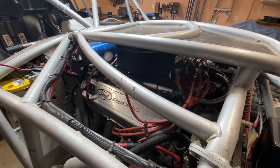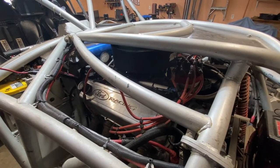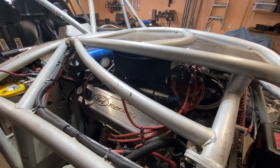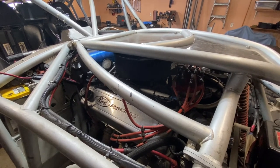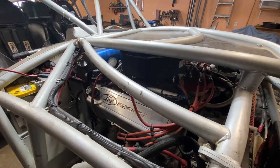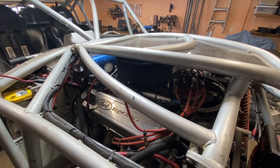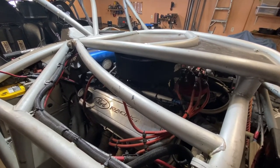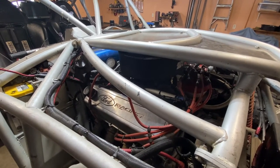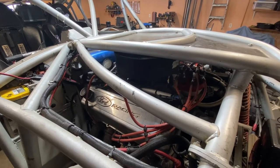The next item I'm going to talk about is the engine itself. My engine still has the PCV valve and I think that's important to keep, because it will suck all the fumes out of the crankcase. Without a PCV, these fumes — which are sometimes acidic — will wreck the engine oil and cause corrosion inside the engine. So it's important to get these fumes out from the crankcase.